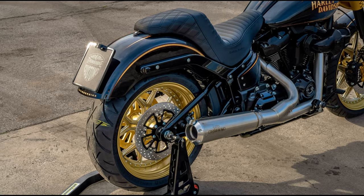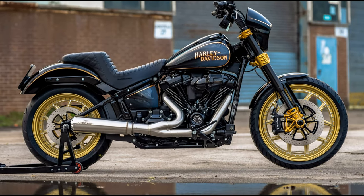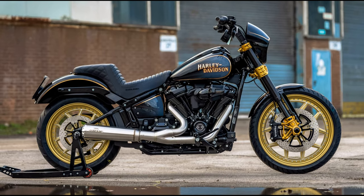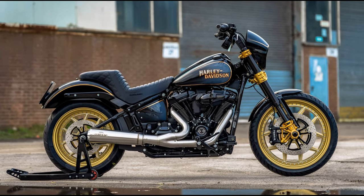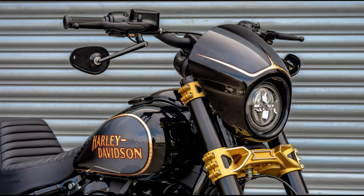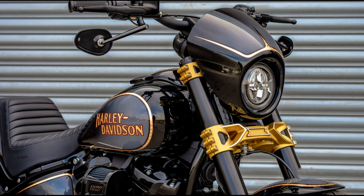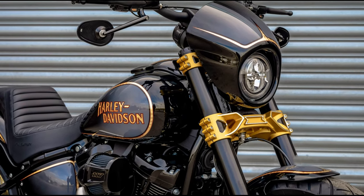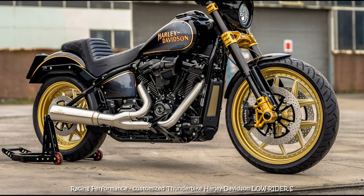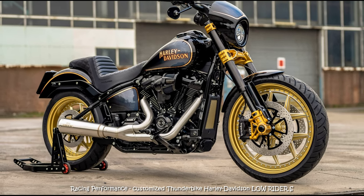The larger rim diameter is the most striking change to the series. At the rear, the diameter has increased from 16 inches to 18 inches and at the front from 19 inches to 21 inches. These are multi-piece wheels that are manufactured in-house and, like the triple clamps, are elaborately milled. Here too, the design elements are refined with a bicolor design after coating on our milling machines, giving these wheels a three-dimensional look.